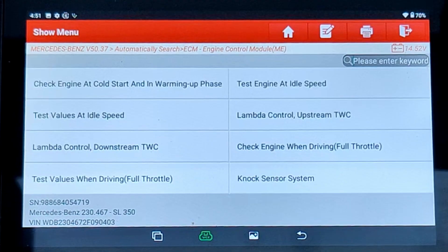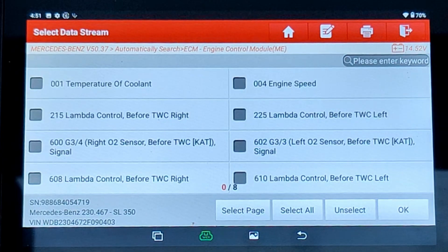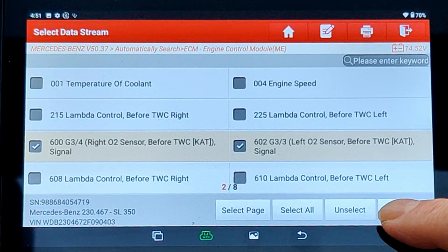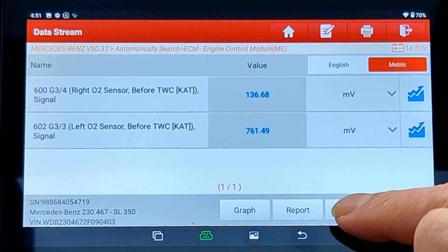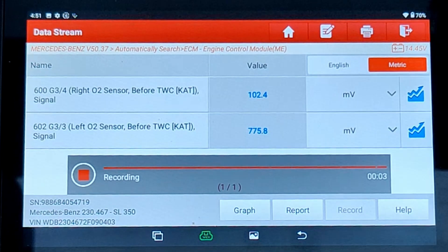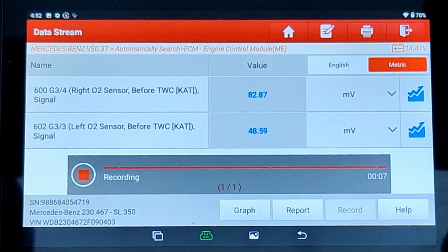Let's go back. I'm going to look at the O2 sensor control unit. I want to have a look at that O2 sensor because that was the one that came up on the initial fault. Let's press OK. It's given me some values - they're fluctuating. You can also record them. Press the record button and it will start to record that screen. As you drive along and see the values or press the revs, you can actually have an indication and look back at it later when you're back in the workshop.